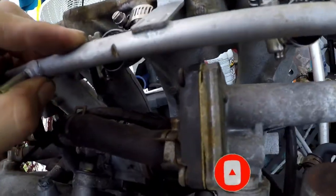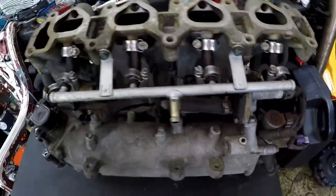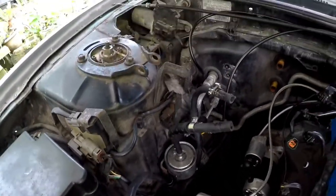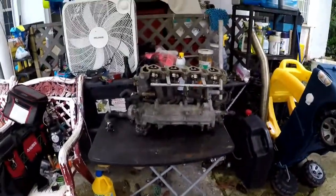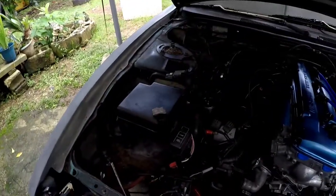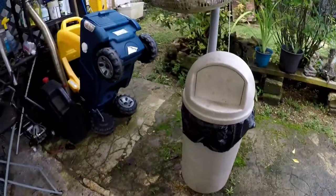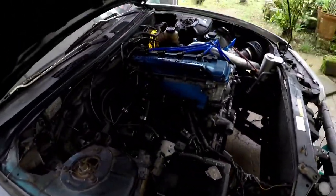Fingers crossed that won't be a vacuum leak later. So I'm gonna go ahead and open the hood, replace the fuel hose that comes out of the fuel filter and the one for the return. Then we're gonna throw the fuel rail back onto the intake manifold, make sure all the vacuum hoses are where they need to be. I also need to fix one more thing on the intake manifold — I'll show you a little goof I did.